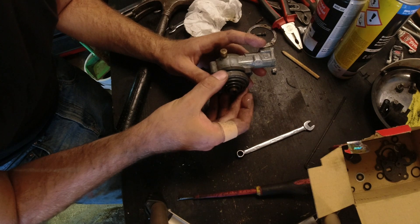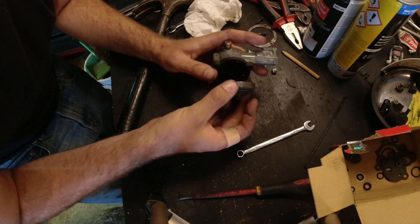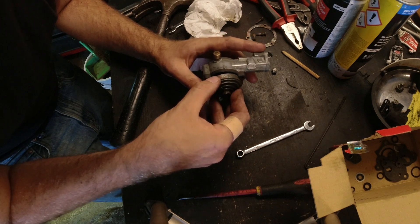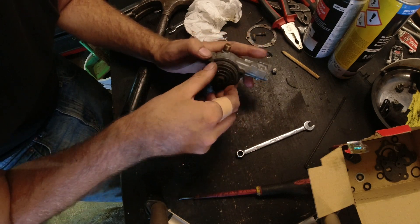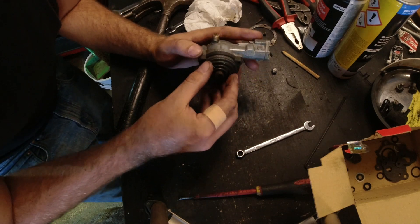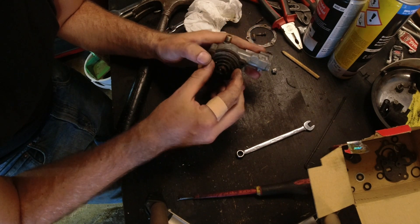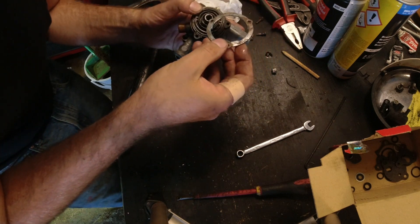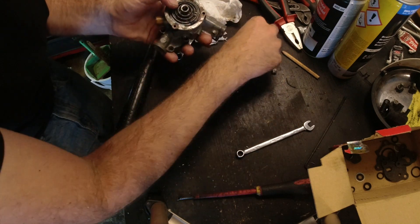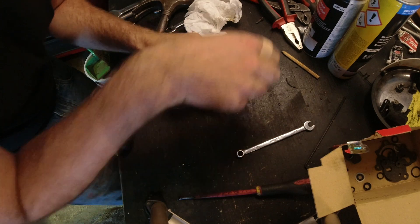What I'm going to do is put it in and rotate it about eight or ten millimeters from the factory position. That should aid in it closing faster, because my guess is that the bimetal is getting a little worn out. Checking it's caught on the thing — that's the normal position — and I'll put it there. Now it's just a matter of putting the whole thing back together, then I'll put it on the car.